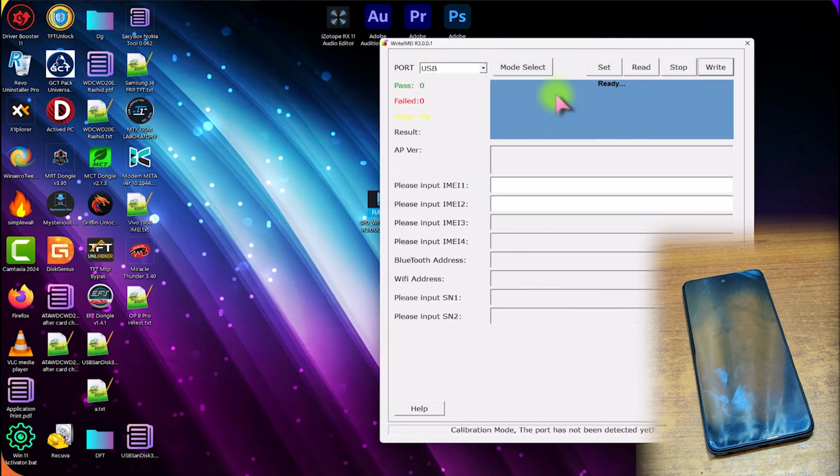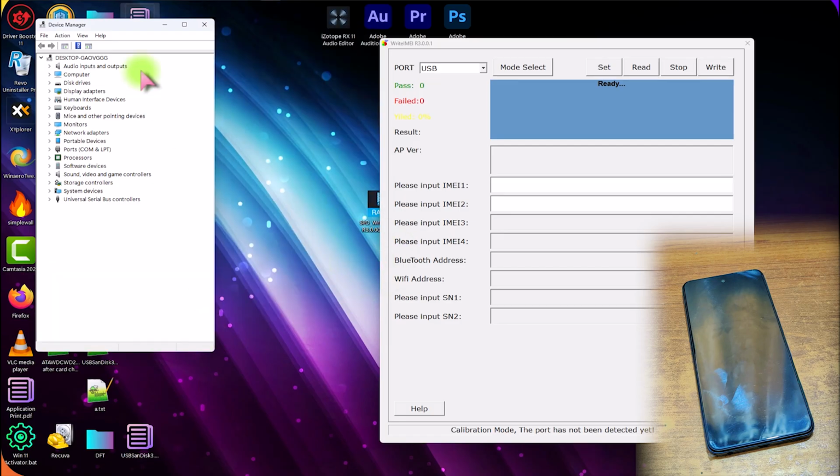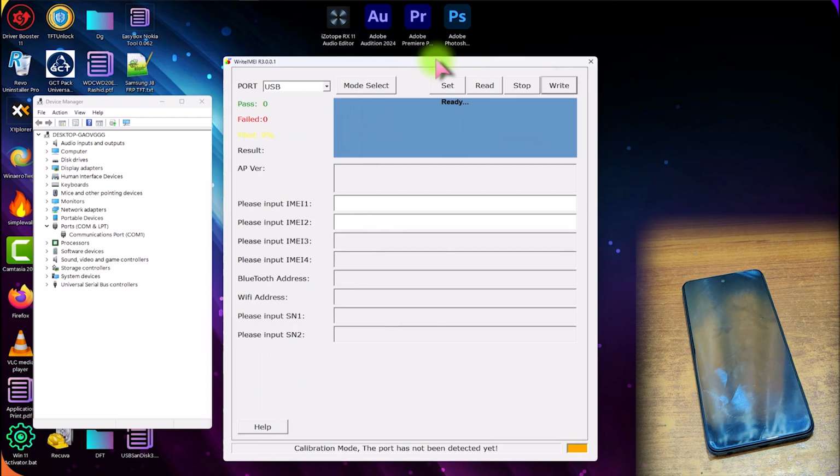Open the device manager by hitting the Windows X and then M key simultaneously. Make sure to install the SPD and UNISOC drivers before starting this procedure. I will place the link of the driver installer in the description. You can download that too. I already installed the UNISOC and SPD drivers.